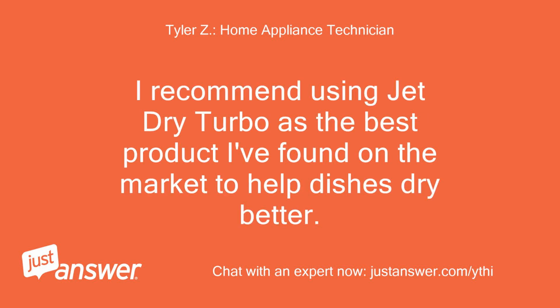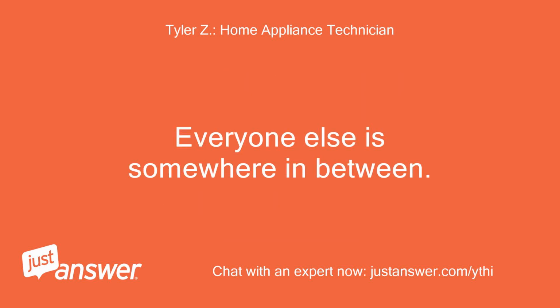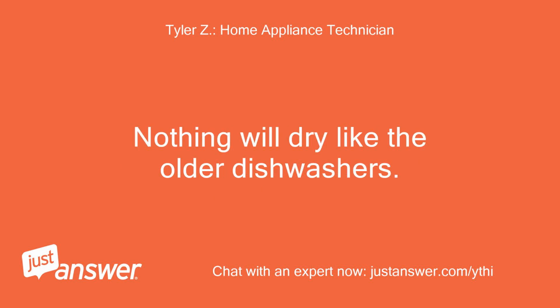I recommend using Jet Dry Turbo as the best product I've found on the market to help dishes dry better. Other than that, some dishwashers have different style heating elements, and I've found the dish drawers to dry the best, ASKO dry the worst. Everyone else is somewhere in between. Nothing will dry like the older dishwashers.